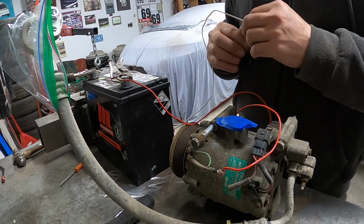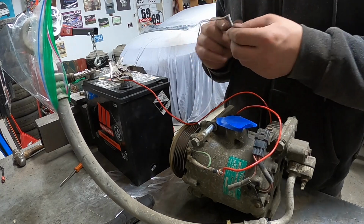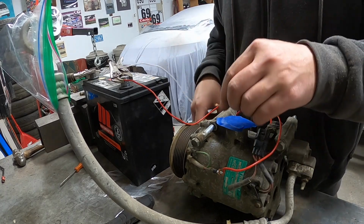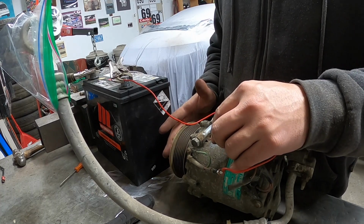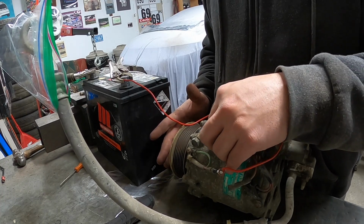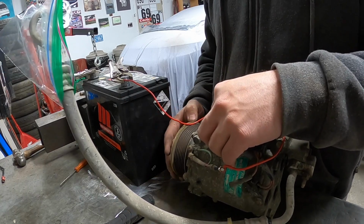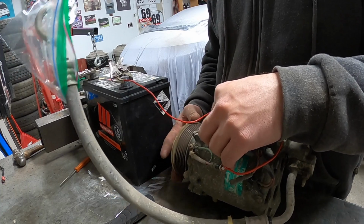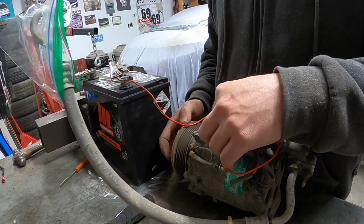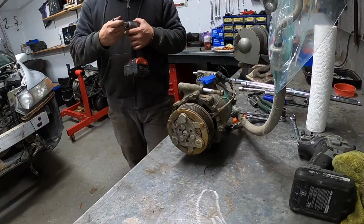Okay, I already preset this up. I've got the power wrapped to the connection on the coil, and I'm just gonna ground this right out onto the chassis, and we should be able to hear it thunk in once the trucks drive by. Okay. There's a very light clunk, but yeah, it does not grab the pulley. I can spin them individually with it pulled in, so no good.